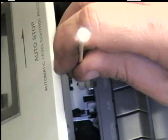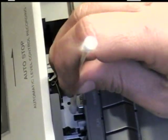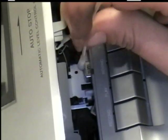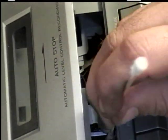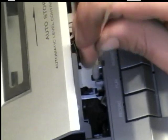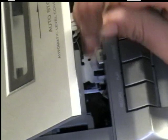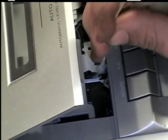Anyway, clean that. Clean the head real good. Clean your recorder head, erase head, playback head. The dirtier it is, the worse it's going to be, and the worse it is, the longer it's going to take to clean. You just have to keep going over and over until the Q-tip finally comes clean, like with the VCR.